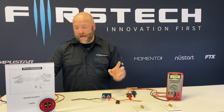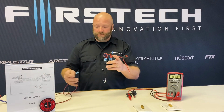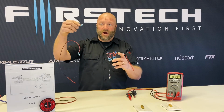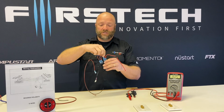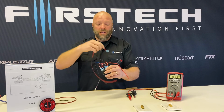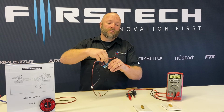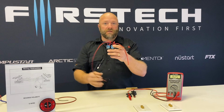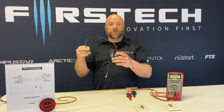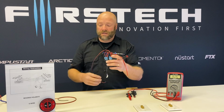So the switch side of that cut wire will go to pin 87A. So you're going to populate pin 87A with just a bare wire that's going to go to the switch side of your cut lock motor wire in the vehicle. The motor side will be pin 30. Again, verified switch side, 12 volts when you actuate the switch. The other side will show no voltage when you actuate the switch. That's how you differentiate between the switch side and the motor side.